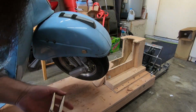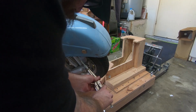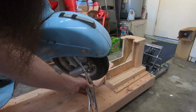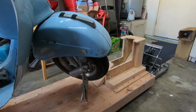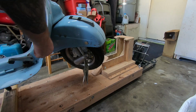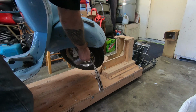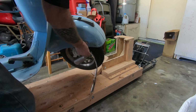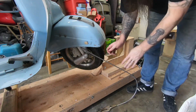So now you take that piece that's through the outer sleeve and you grab onto it with some vice grips, so that it holds onto it and you don't want the cable sliding back through the other side. And now with it clamped, you take your new cable and you push it down into the fork and pull out from this side. I was getting hung up.